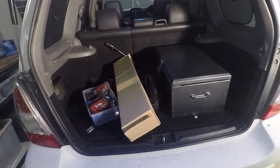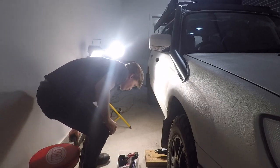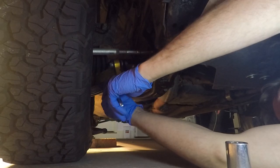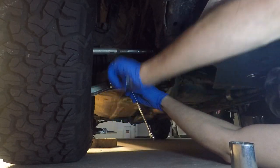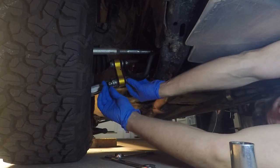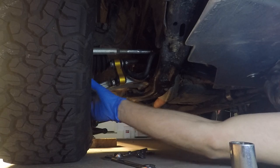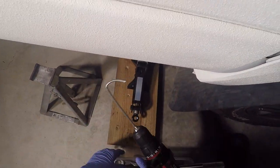I've got all the tools I need to take off the tire and the CV: the jack and a jack stand. The first thing to do is disconnect the sway bar — that makes it a bit easier to push down the lower control arm. I definitely recommend disconnecting the sway bar end link when the car is flat on the ground; it makes it so much easier. Then all we've got to do is take the wheel off and jack up the car. I'll lower it down onto the jack stand.